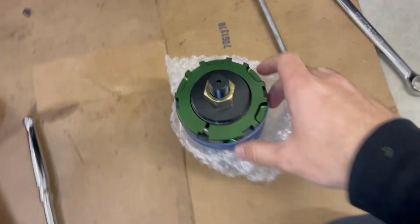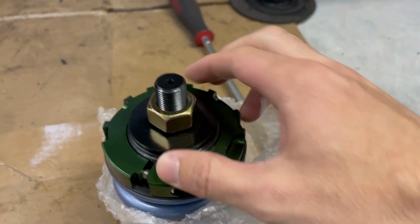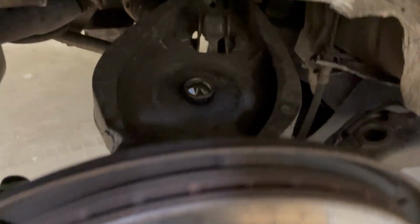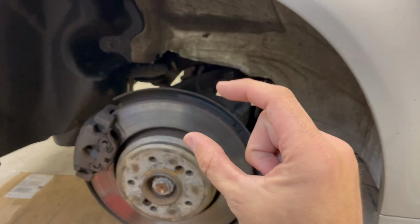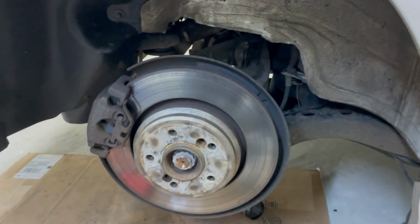One thing to note about these is this nut as well as this collar are actually gonna go in below on the bottom here. And now I was confused by that because there's not much clearance to the axle when you do that. But if you can finagle it in there, once the suspension is lifted back up at ride height, there's plenty of clearance between the bottom of this and the axle. So we'll go ahead and get that installed, and we'll get the strut tossed up in there as well. You can see there is no cracks, which is a beautiful thing.